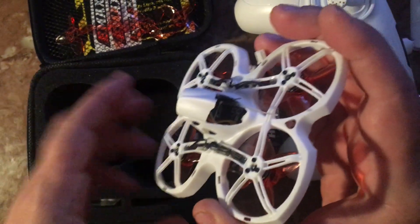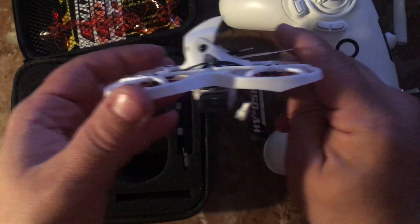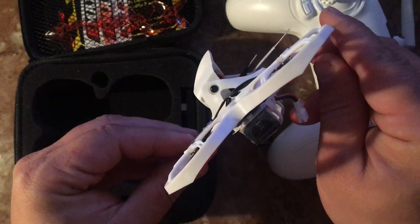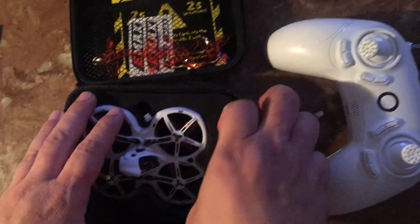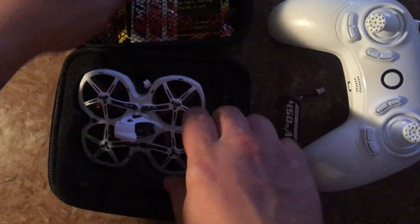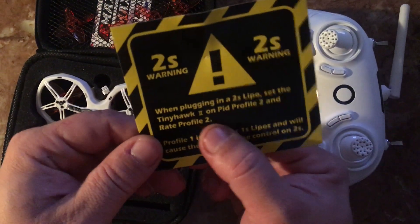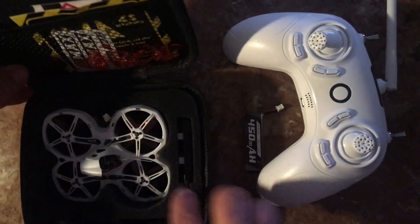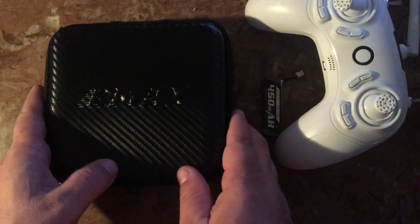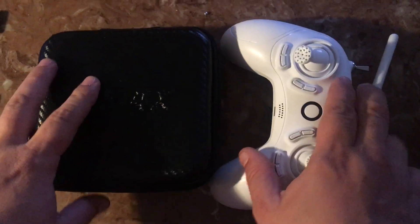With the camera pointing around 35–45 degrees, and when you're on 1S the quad is going to be more level so the camera sits more forward. When flying acro you'll be angled more aggressively. It comes with a charging board balance charger. When running 2S you'll need to check your PIDs in Betaflight — make sure you're on profile 2. You also get extra props, stickers, and a nice case. Get on Banggood and get your drones — you're missing out, it's too much fun!